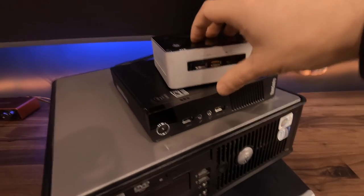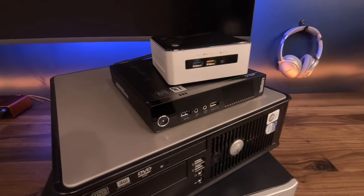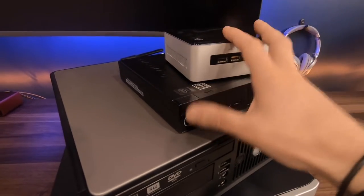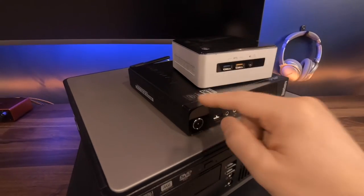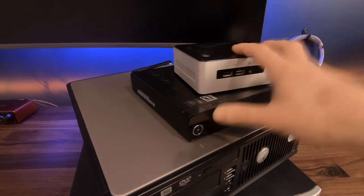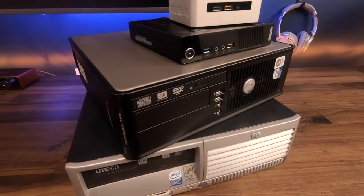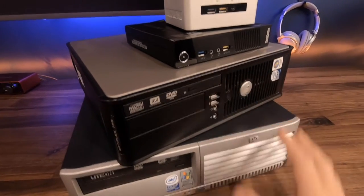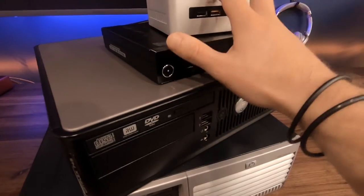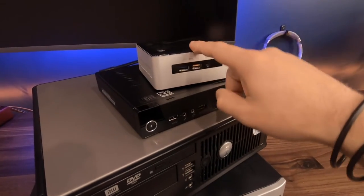While these are a little bit more compact, they're more custom built. So even though you can upgrade the components in these, it's going to be a little bit more difficult because there's not as much space. You're also not going to be able to upgrade to the most powerful CPU because the motherboard may not support a newer CPU. These two are a little older — these are older Intel Core 2s — while these are faster: this one's an i5 and this one up top is an i7 Intel processor.